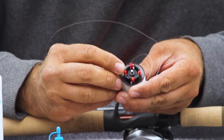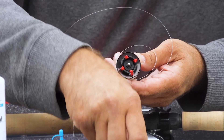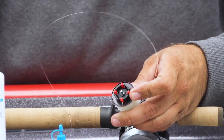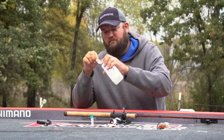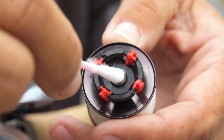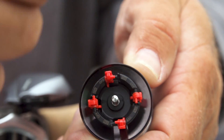So you've got your little brake blocks right here. You can see they've got a little bit of dirt build-up on them on these edges right here. You're going to take a Q-tip and a little bit of rubbing alcohol and clean off any of that dirt, excess oil, anything that's on there. Clean all that stuff off.